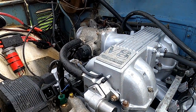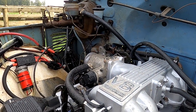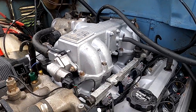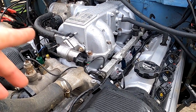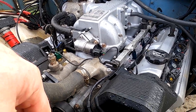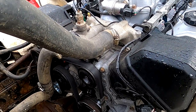And then I just fired an engine start in. It did a big pop out the intake. Knowing that it's firing number, like number one's come to TDC, but it's firing number six. So I'm 180, a crankshaft revolution out. Move it to the correct spot, recheck it, and that's how I actually worked out the timing.